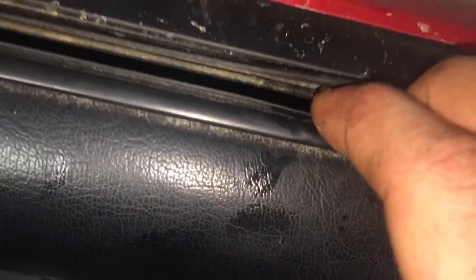Right now I'm just draining my cooling system, so sorry if it's a little loud. Now here's a quick tip: if you don't want to go ahead and take off your door panels, if you look right here there's a little crack and you can see where I sprayed some. I'm not going to be able to get the camera in there, but if you get on the right angle of the light and you're looking down at it, you can just grab your silicone spray, stick your nozzle in there, and spray it. You really want to get it good in there.